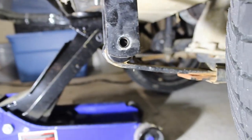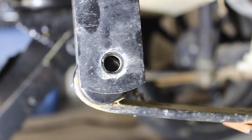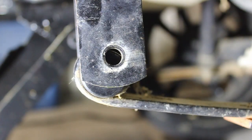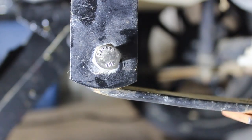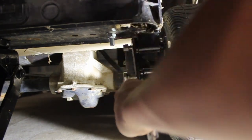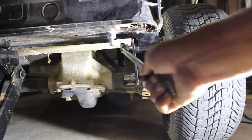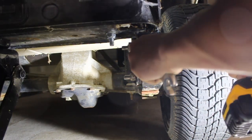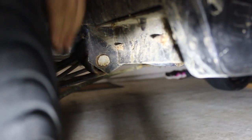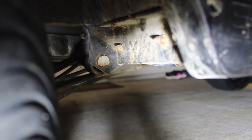The hole in the leaf spring is not aligning, so I need to push this up a bit more so the other side can get through. Okay, there we go — tighten them up, same thing on the top. Look, you see all that movement? Yeah, it's gone.